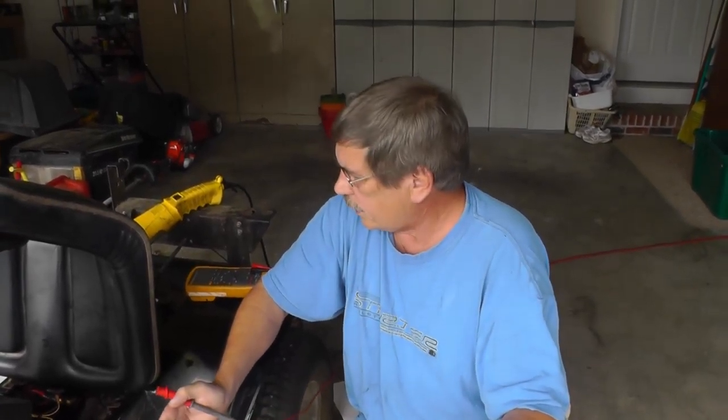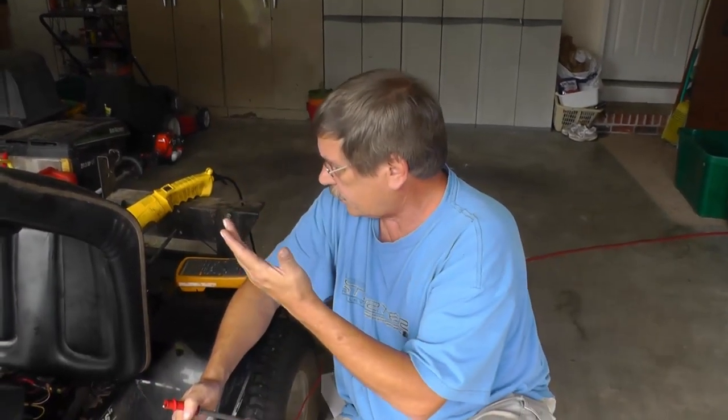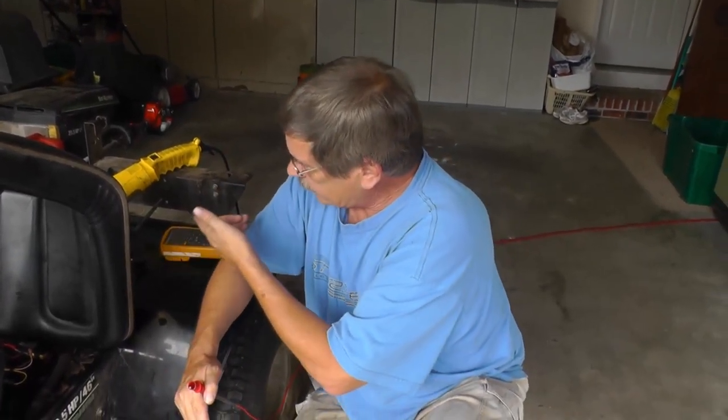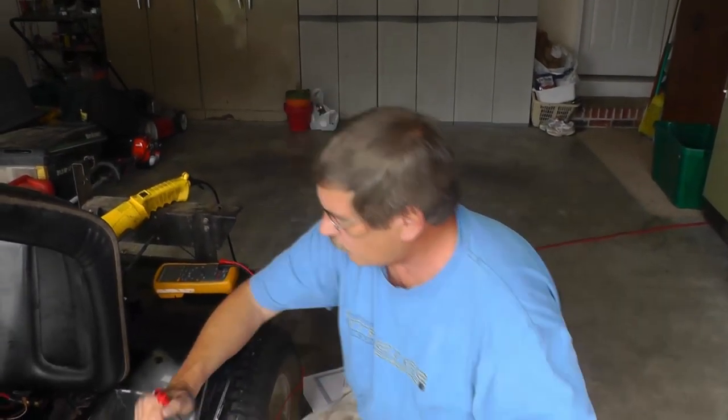Okay, so we can actually measure the voltage that's dropped across cables, wires, terminals, as I mentioned, battery posts. And I'm going to give you an example here where we can measure, maybe I'm suspecting that this here negative cable that's going out, let's say, maybe there's too much voltage, I'm losing voltage, I've got corrosion. All right, so here's how we can do that.